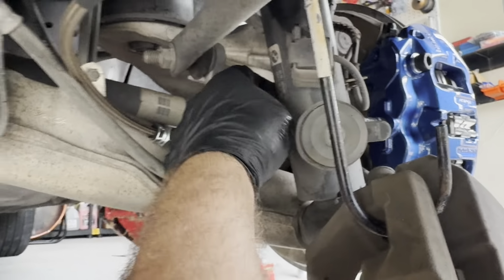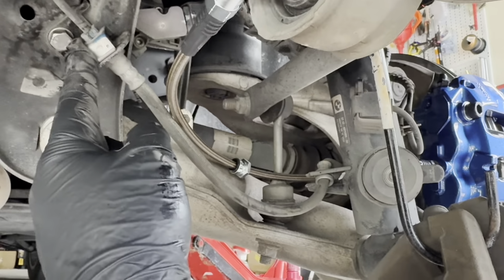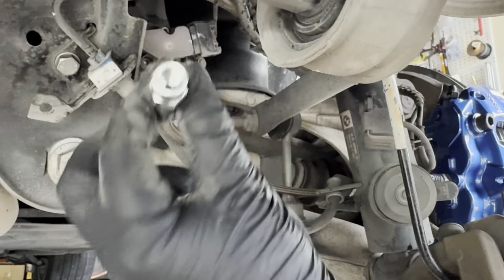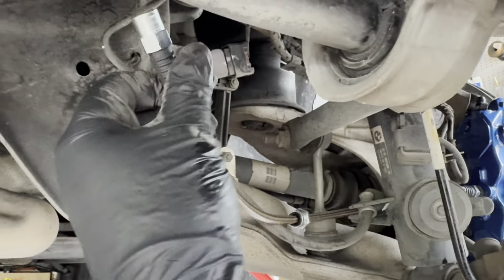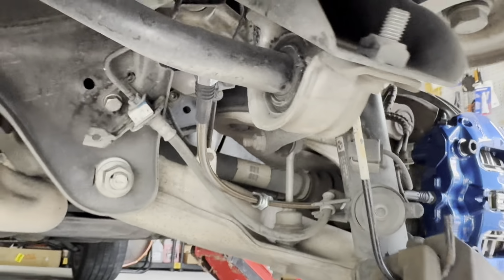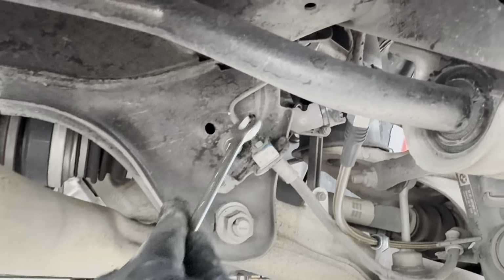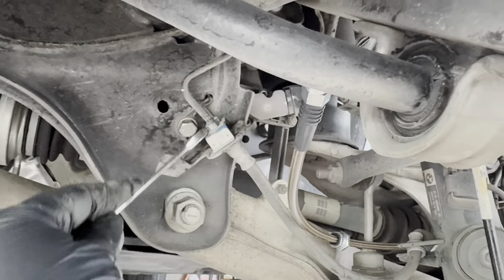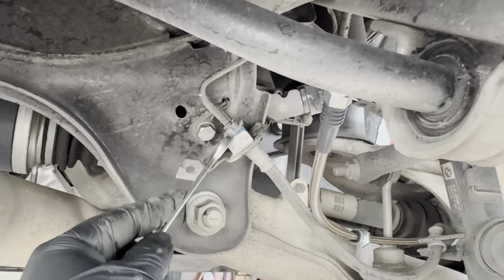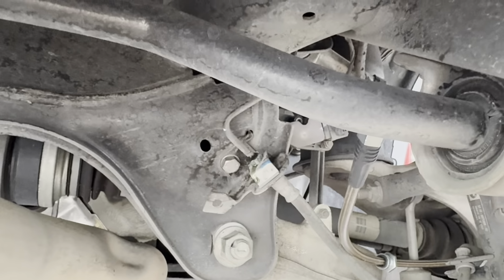So this piece is loose. So what we're gonna do next is we're gonna loosen that brake line and we're gonna connect this StopTech line to the factory hard line. Just fairly easy. Just gonna start loosening this deal here a little bit. Little by little, it's gonna start leaking some fluid. It's not gonna be crazy, just a little bit. And there you go, see it's coming.